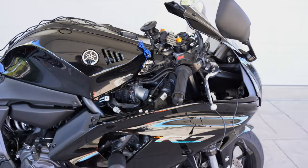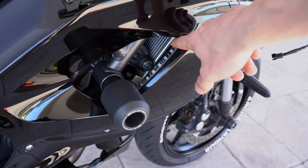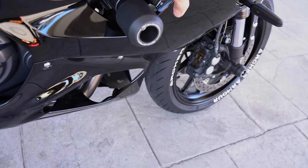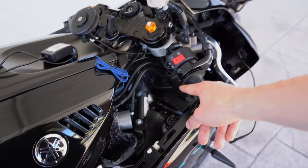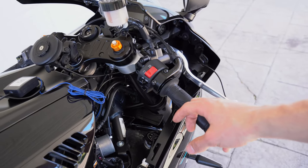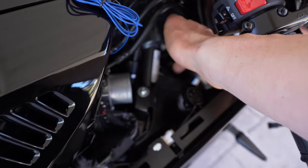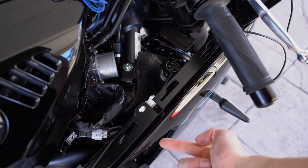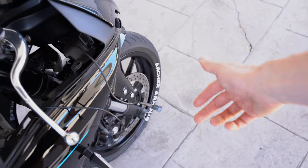I'm going to get the other side done now. This side was a bit easier — just put it in the same spot, just here. Make sure you hold them down once they're in position so they're stuck. You need to take the fairing off for this side too — there are three little pop screws and a normal screw, very simple. Once it's out there's a rubber piece; I lifted it from the top, pushed the cord from under straight out the top, and it's sitting out the side next to the other cord from the front.